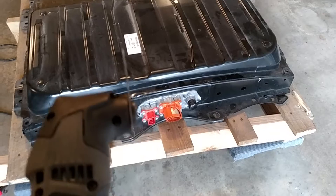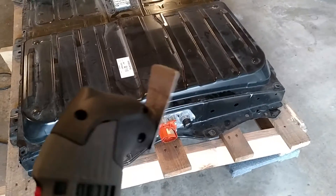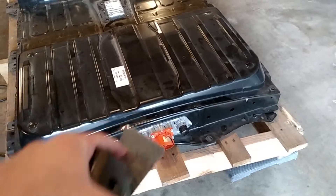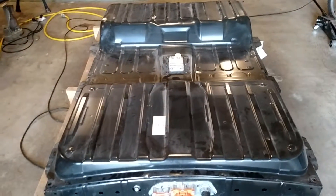I had to modify the blade — it was bent in a couple places and I had to take it down to the vise and beat on it with a hammer to make it straight, because I didn't have the depth. It was hitting this first notch here and that wasn't deep enough to get down to the gasket material, because it has to go in pretty deep. So the blade goes all the way in there to hit metal — I could only get in that far, so I had to unbend it to get in all the way. It barely does it but made quick work of it. Ready to take a look inside — I don't know how heavy this cover is, I've not opened it yet.